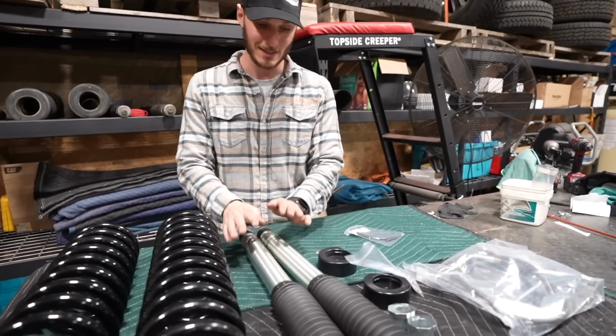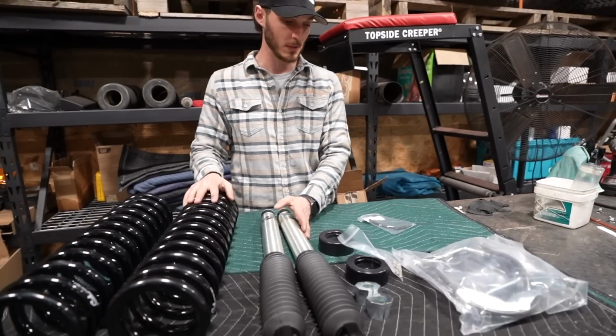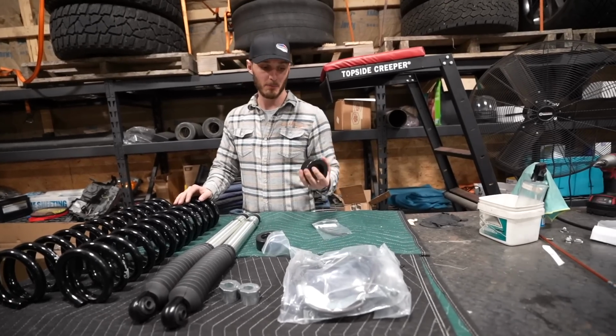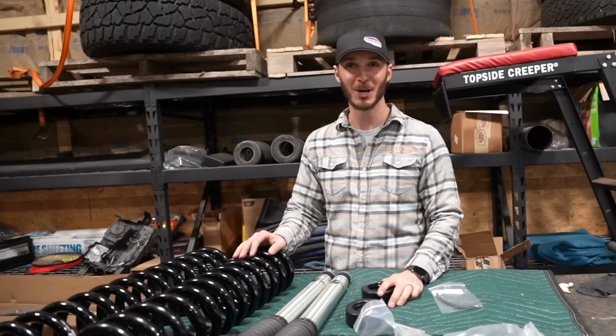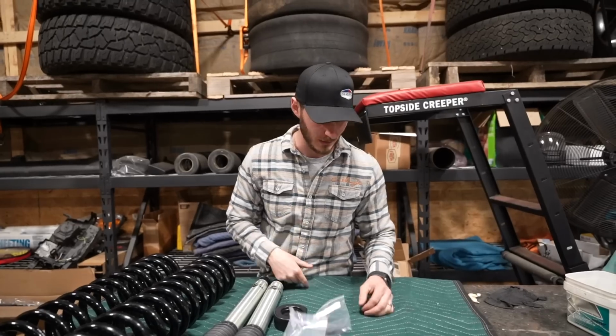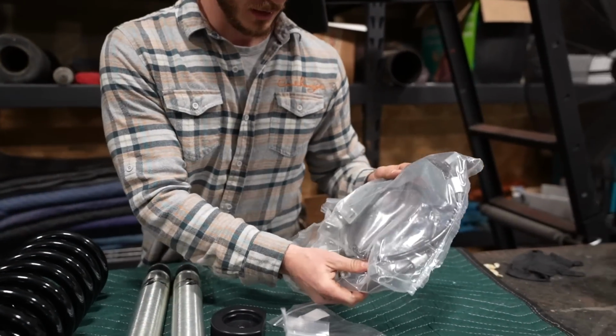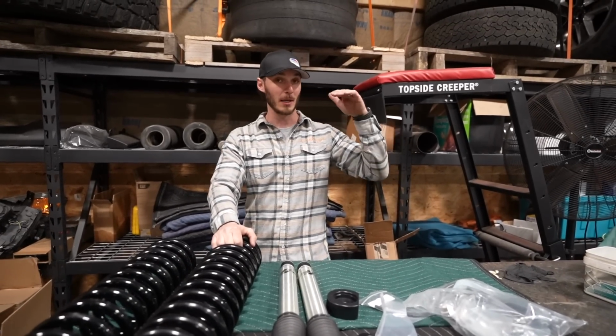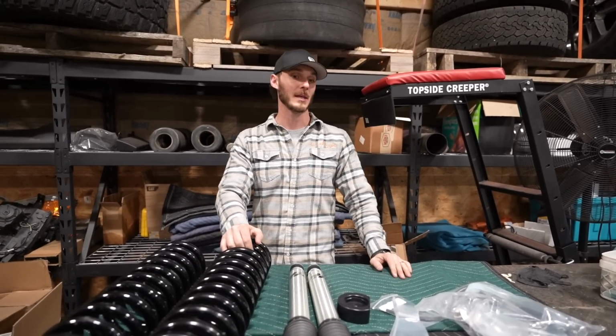But these are basically extended shocks because we're adding 2.5 inches up front. We've got our caster adjusters right here. We've got our bump stop brackets, pucks, drop puck. These are the spacers for the bump stops, essentially, the hardware, extended vent hose, and we've got extended braided brake lines. This is essentially going to get my F450 level so we can throw in the bigger wheel and tire setup in the next video.